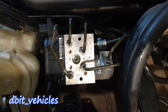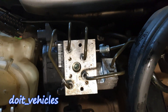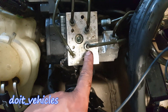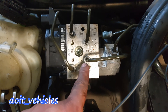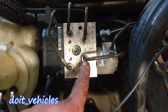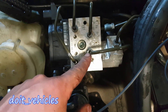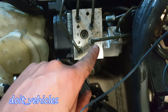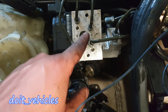Can you guess which one of the bolts is not straight? It's this one - you can see it doesn't go straight in there. You do not want to force the threads because once you force the threads all that material will go down and the line will not seal completely on the port and the line will leak.